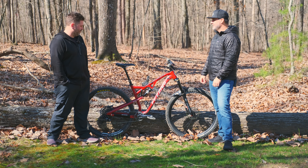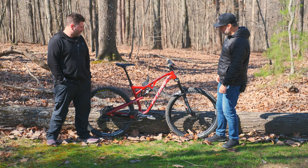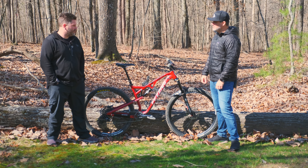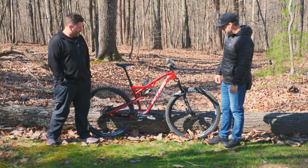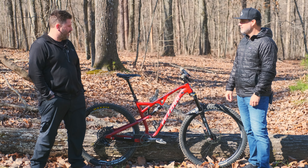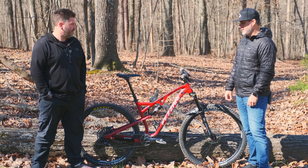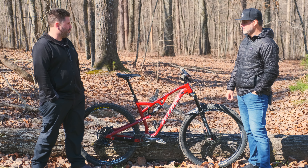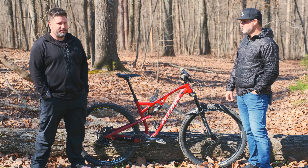Gene: First off, you've definitely gotten your money's worth out of this bike and this build — you've done a heck of a lot with it. The thing we're running into is that you've kind of reached what the suspension can do for you — reached its max potential. To dive a bit deeper: you're having to max out your air pressure basically to not blow through the complete travel of that suspension setup, which makes the off-the-top feel really, really harsh and pogo-y.